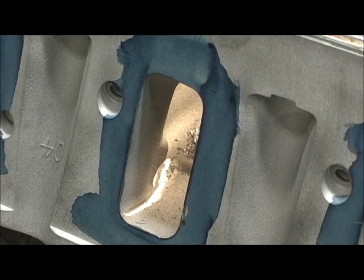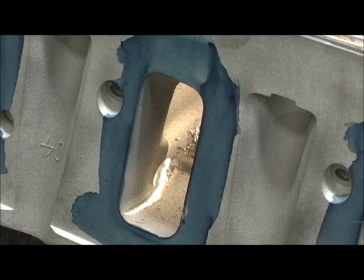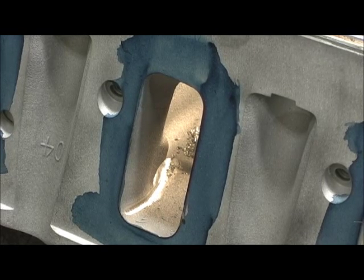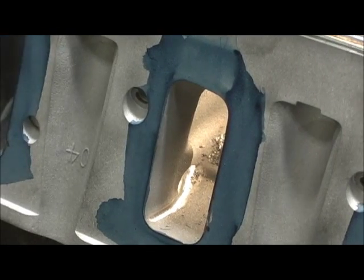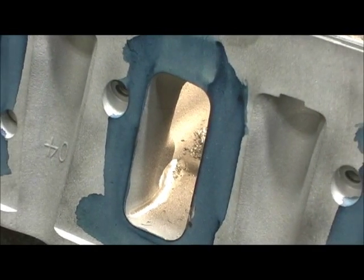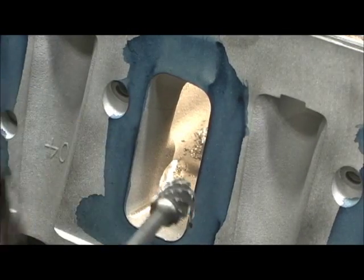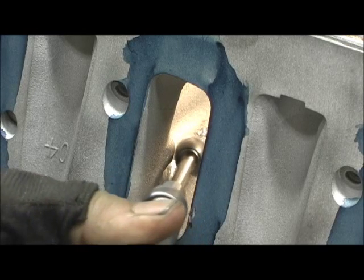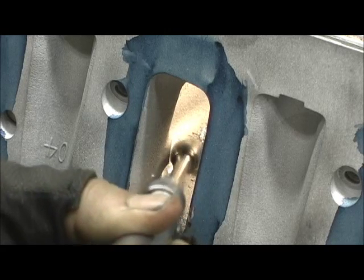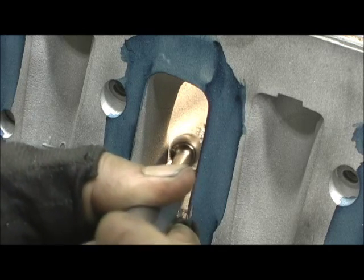It's going to be a hard one to see because it's going around a pretty sharp, abrupt corner, and I know that my die grinder and my hand might get in the way — but basically it's that sharp bulge right there. That's where the rocker stud goes, and what you've got to do is, without going too much into this wall, go in here and pull that out.